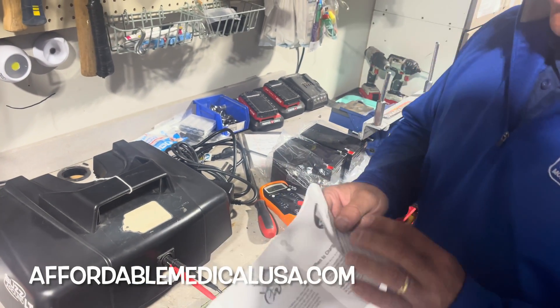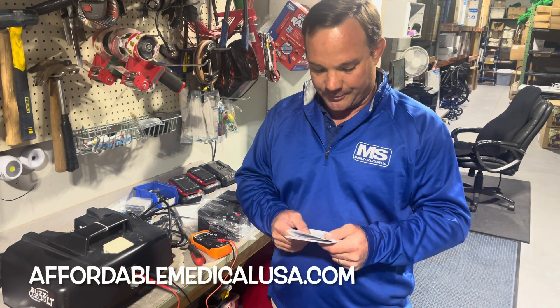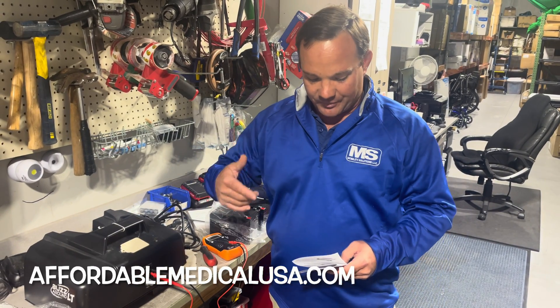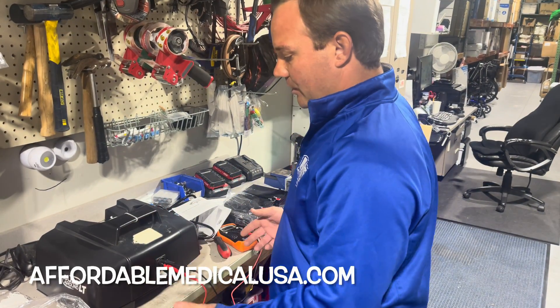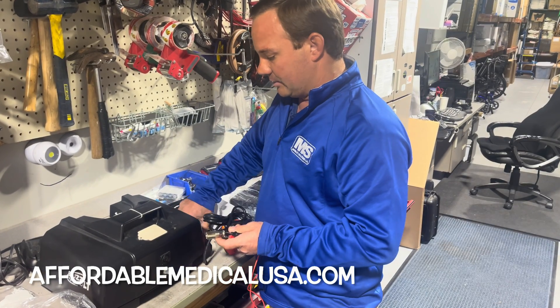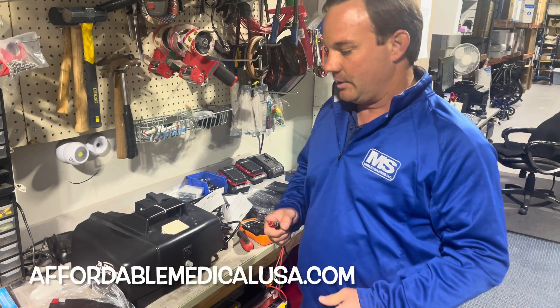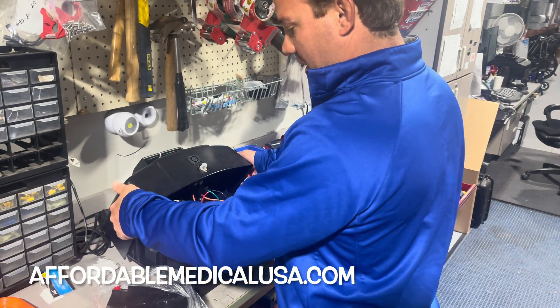Storage and maintenance is the biggest key to these things, because the biggest problem with these scooters is people aren't maintaining their batteries. They buy it, might use it three or four times a year. If you use it every day you don't have to worry as much, but you want to fully charge the batteries, keep them in a room-temperature environment, and check on it once a month. Basically, if I wasn't going to use the scooter for a while, I'd plug my charger in once a month, let it fully charge up, disconnect, and store it. That will help you save money on batteries. This is just a little Buzz Around LT with little 12Ah batteries — deep cycle, dry sealed.